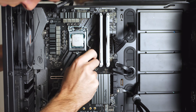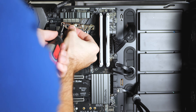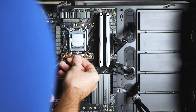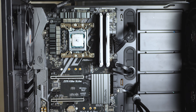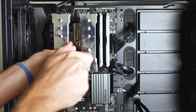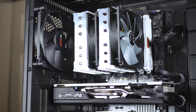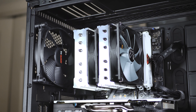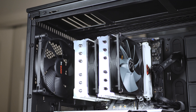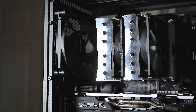The installation process is really easy and it does support AM4. The installation I did was for LGA 1151 — all that needed to be done was sit the back plate behind the motherboard, screw in the mounting posts, screw in the mounting frame into those posts, then attach the cross brace onto the cooler and screw it into the mounting frame, then install the fans with the fan clips. The only tricky part was installing the middle fan — it's a very narrow gap between those fin towers and it was hard to squeeze the fan in. Other than that, installation was really easy and all parts are top-notch quality, all metal except for the fans of course.